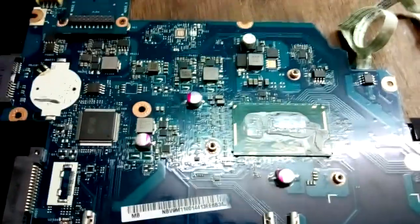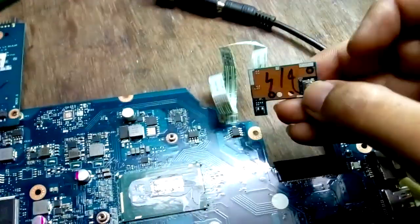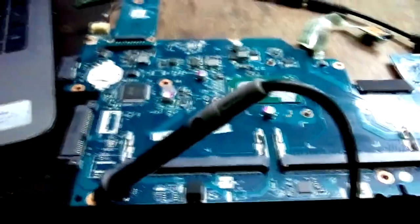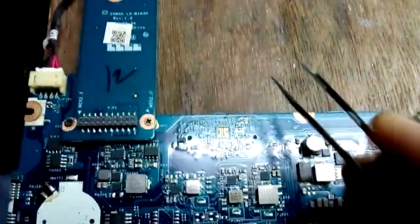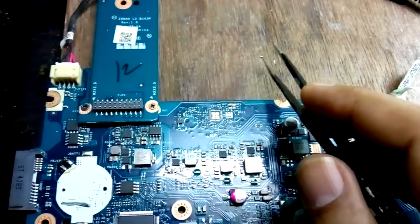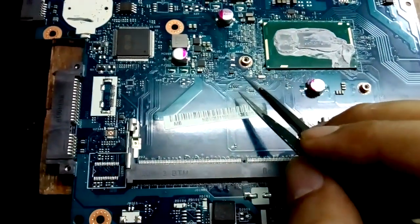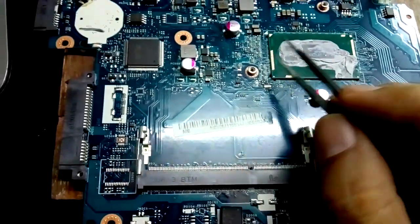The problem is exactly that the motherboard is not turning on. I found the fault — this capacitor is faulty and is pulling down the RTC VCC voltage to ground, causing the voltage to drop. This capacitor is connected to the 3.3 volt line. So I will connect the RTC VCC from here directly to the RTC section to bypass it.